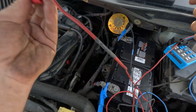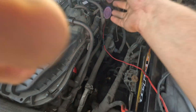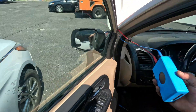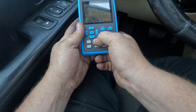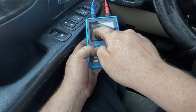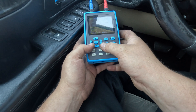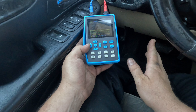I'll ground this side of the scope and plug into over here. I don't know the voltage to set this to because usually when I'm using this I'm using it on the Pico. Let's get in the car to see the screen. Step one — turn it on. Hold down channel one, channel two — it turned on channel two so you now have a green line. Channel two: click menu, chances are it's on DC, that's good. I'm going to put it on a one volt per division scale. Push menu, switch to channel two — we're controlling channel two now, on one volt per division.